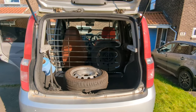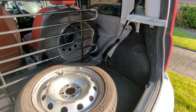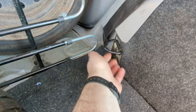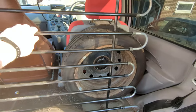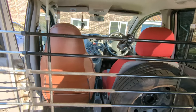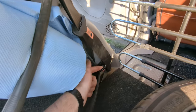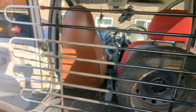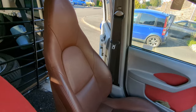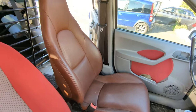As you will have seen in some of our videos, my dog likes to come greenlaning with us. For that reason I've removed the rear seats and put a cage in to give him plenty of space to lie down and look out the window. These little hooks provide strap-down points if I'm carrying anything, and the cage can be easily removed to give lots of space for large items. You can also see a Mark II MX-5 seat on the passenger side with a custom made seat adapter using box section and stainless bar, and I'm in the process of doing the same on the driver's side.